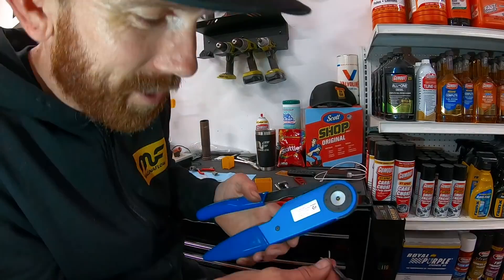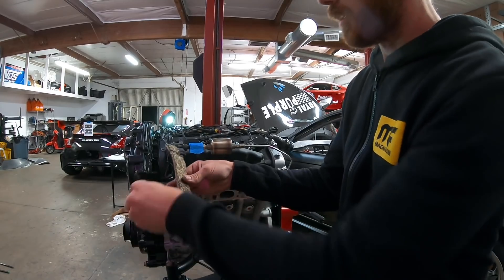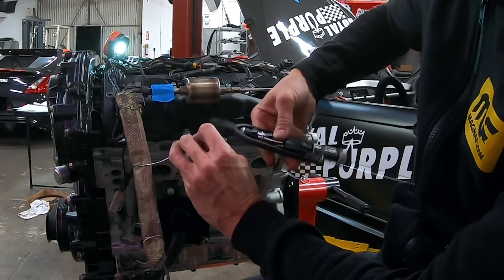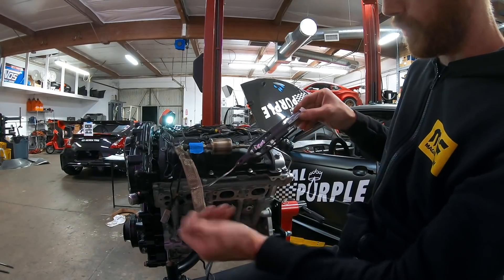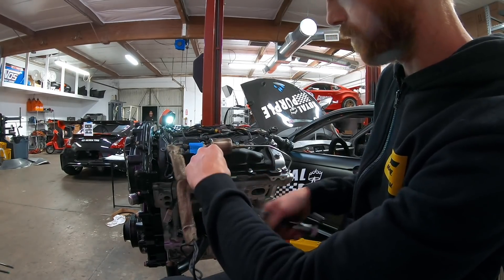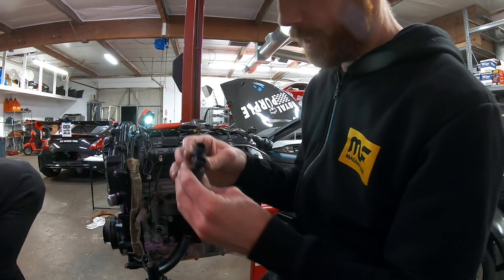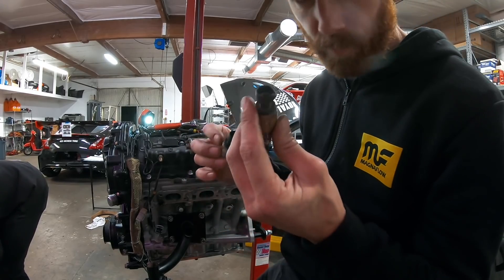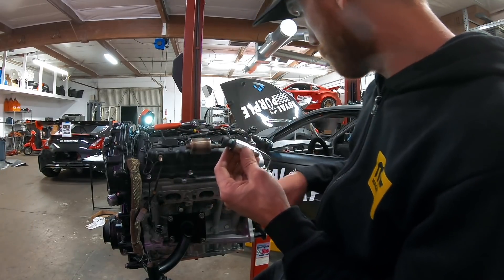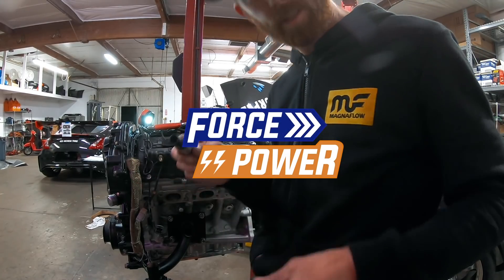Now I've got to fix the engine harness side. Last but not least, this nice little protective blanket over it, and then I'm just doing some safety wire to hold it in place. These little guys have a little locking clamp - grab on to the end and now it's basically on there. This is where all of our melting happened last time - that header comes over. Quadruple layered this time. And then last but not least, we have our fried sensor that we had to change the connector on. Went on a brand new AEM pressure sensor. This goes into our exhaust back pressure canister, which reads the pressure in the manifold to make sure that our turbos are not too pissed off. Put this guy in and we're good to drop this motor.